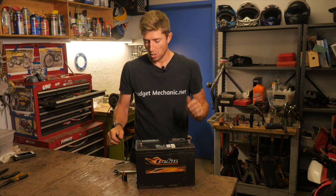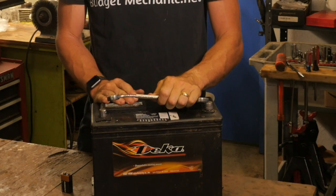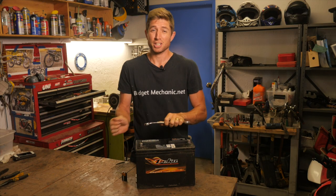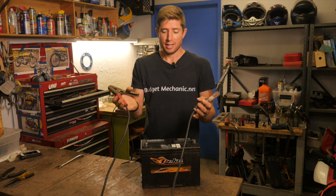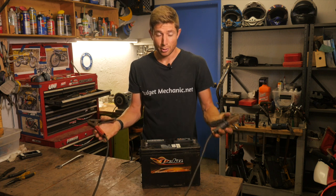So though it's low voltage, these batteries are high amperage, which basically means if we were to touch these terminals together using wire or something metal like a wrench, you're going to get a lot of sparks and potentially a lot of heat very quickly. I'm just going to touch them really quick right now. You can see big sparks, and if I were to leave that on there long enough, the metal might actually fuse and you'd have a complete circuit — and that could be a pretty bad and hot situation. Another example of this is when people are jump starting their car and they cross the cables, so the positive from one goes to the negative of another, basically completing the circuit directly. I've seen jumper cables melt and the clamps get super hot, which is bad. You might get burned, might ruin your cables and your battery, but again, not going to stop your heart or electrocute you.